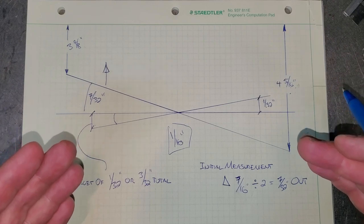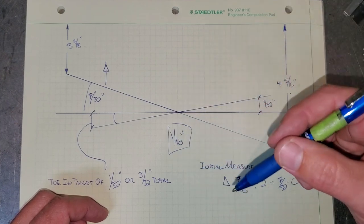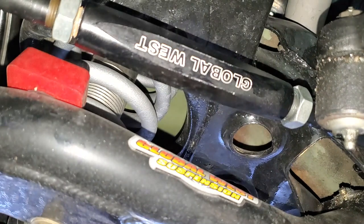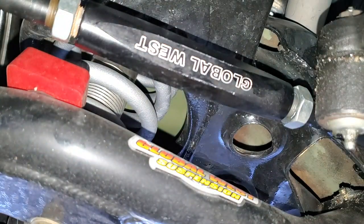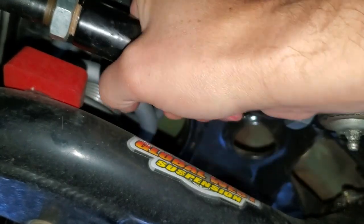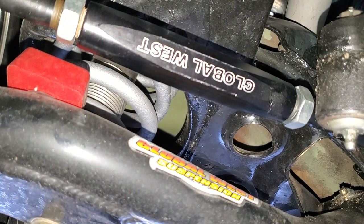Let's jump to the car and look at the tie rods. Here's my adjustable tie rod. There are two lock nuts on each end — be aware one is right-hand thread and the other is left-hand thread. Look at the threads before you try to loosen the nut. You may need some Liquid Wrench to get them loose. I can turn it and you can see it growing — so I'm going the wrong way. I need to turn this way. I'll keep going back and forth until we get that one-sixteenth of an inch difference.